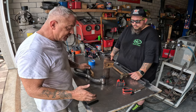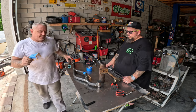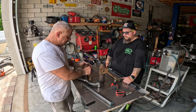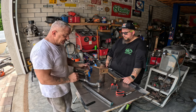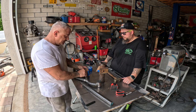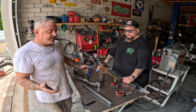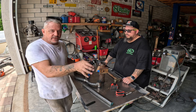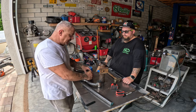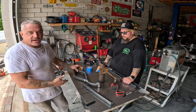So I'm left with a couple of decisions. I'm going to reach out to the customer. Big shout out to Tim for helping me today with all this — he made me some brackets for the airbag. All I have to do now is adjust the height of how this is. If I raise one side up, it flattens the bag out. Or if I change the position for the cantilever and mount it right here — the bridge isn't made yet. I don't want to go outside the arc of the chassis rail, or I risk cutting through the floor. I could mount it here and shorten or lengthen one side.